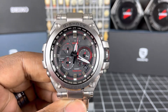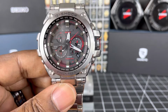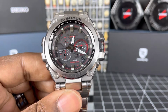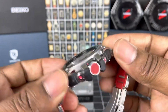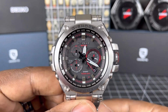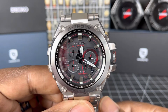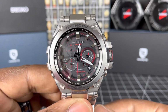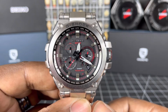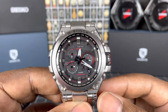So I ordered a new battery for it. The battery arrived around 2 months later, and I fitted it. Not new to fitting batteries, so I unscrewed the watch case, removed the battery, and replaced it like for like, negative contact upwards, and then proceeded to do the AC reset. Then I set the watch on the windowsill after putting it back together, for a week, so that it would get everything it needed, charging, syncing, what have you, even though it wasn't set to the time zone that I'm in. And it still isn't working.